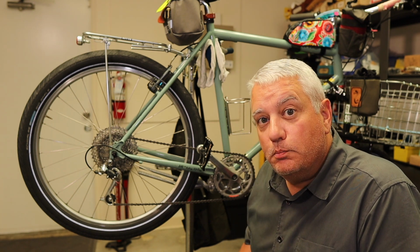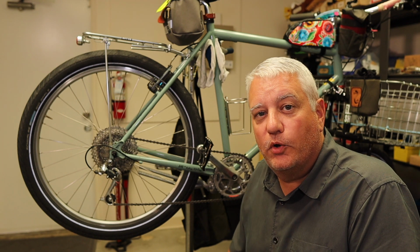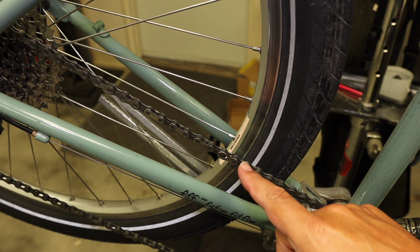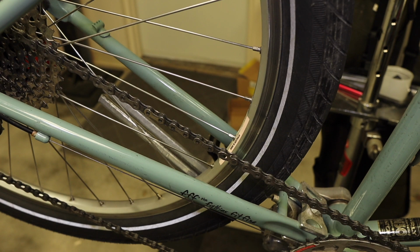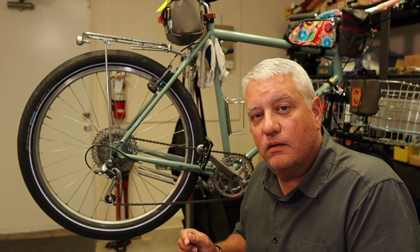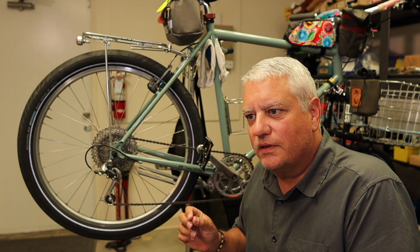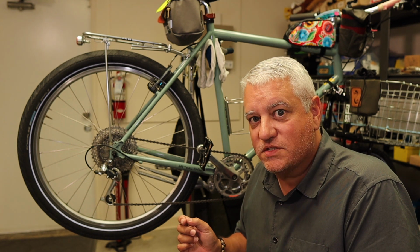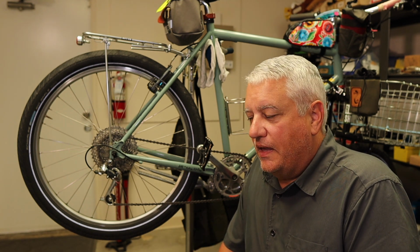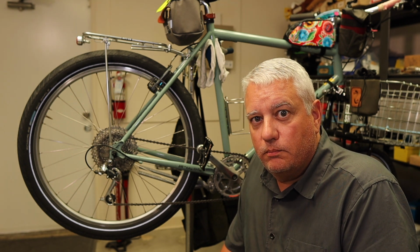The way that I lube my chain is I'm going to find a place that I can find again. Most bikes now have connecting links. If your bike doesn't have a connecting link, but you've got a Shimano chain that's pinned together, that pin that's used to put the chain together generally looks a little different than the rest. You can use that as a reference. If you can't do either of those things, just take a Sharpie and mark one of the pins.